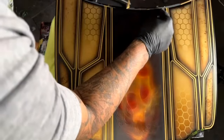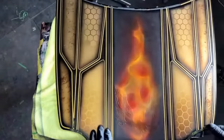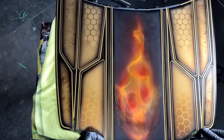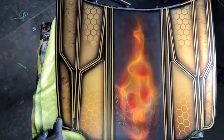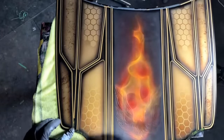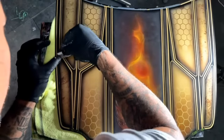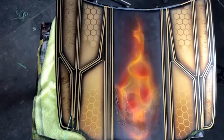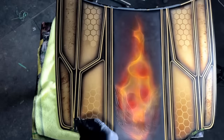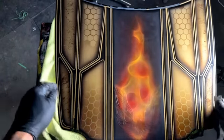All right, well. Huh, that's too bad. We had some paint peel on the edge here. When I went to base coat this, I obviously did not scuff the edges down good enough. I still got some, hold on, I got one more. I was hoping that those little errors would just be contained to those couple of areas, but it looks like it was worse than I thought. We got paint peel here, this edge right here. And look right here.